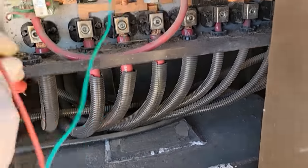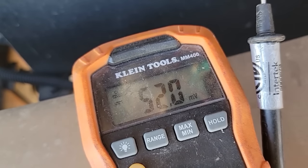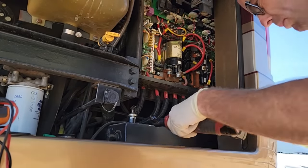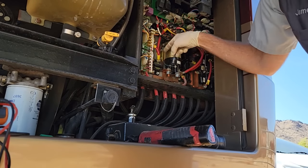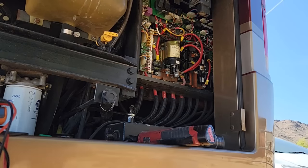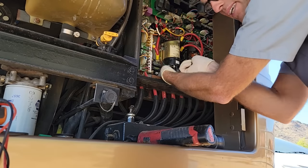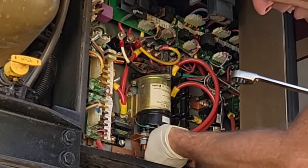Let's go ahead and verify we don't have any battery power on it. There's some millivolts bleeding off, and over here we're at zero. So hopefully this shouldn't be too much work. It's just going to be three-eighths bolts back there — four of those — some three-eighths nuts right there for the coil — two of those — and three-quarter inch bolts down here. We already checked to make sure there's no voltage there. I have a ratcheting wrench so that'll make this easier. Take a picture so you know what it looks like when you're done, and hook it up right.